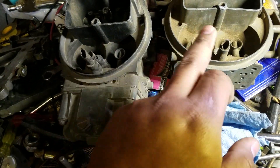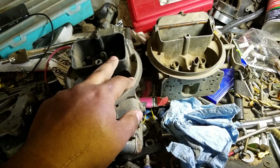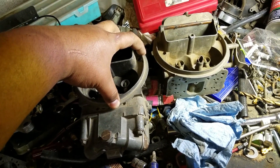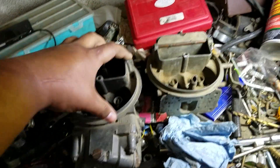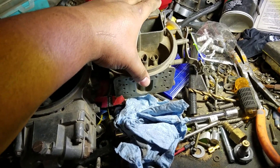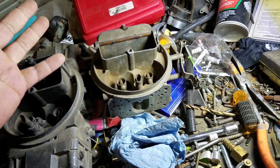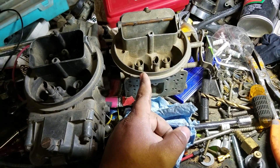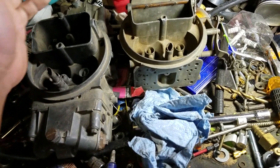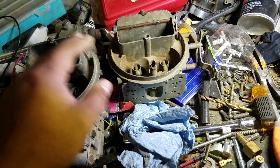So which one should you get? Nine times out of ten you'll want to go with the 650, because it already comes with the larger base plate. If you ever want to change the main body to a higher CFM — 700, 750, or 800 — the only thing you'd need to change is the main body itself. With a 600, you'd also need to replace the base plate, and at that point you might as well just buy a whole new carburetor. I'd only recommend the 600 if your application already came with one, or if you've got one laying around like an 1850 vacuum secondary — you can tune it to perform like a 650.